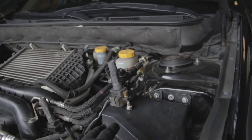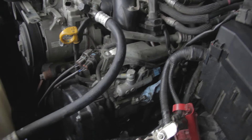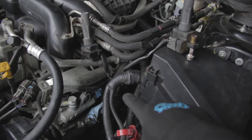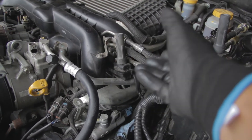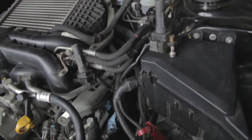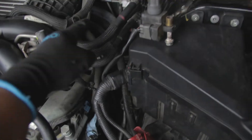We got the coil packs out — you unscrew the bolts, they don't come all the way out, so once they're loose just wiggle them out. Long helped me; the first one wasn't too bad. There is a little trick: wiggle them, then angle them as you pull. For the back one, Long said to grab it once it's loose, pull it out, then turn it 180 degrees clockwise and pull it towards the back. The shorter one goes to the back, the longer one goes to the front.